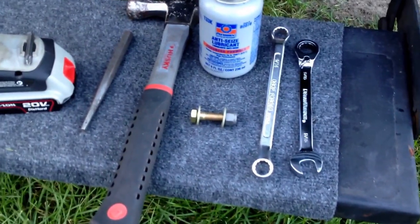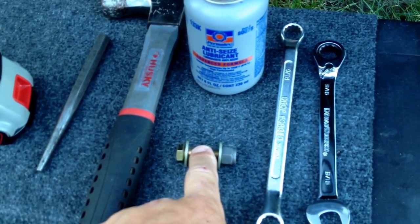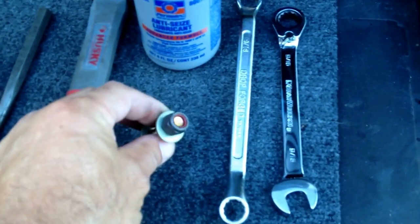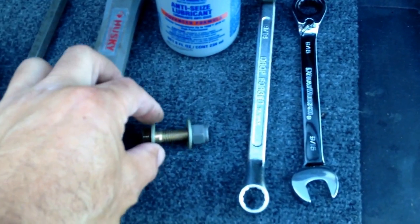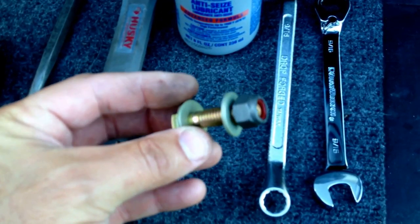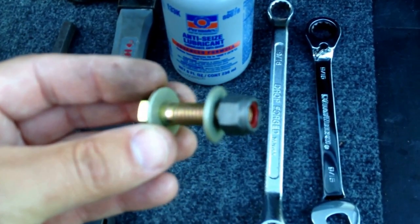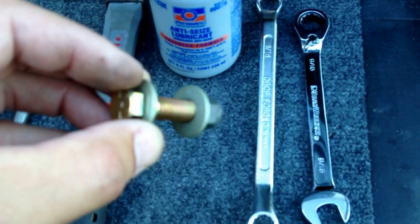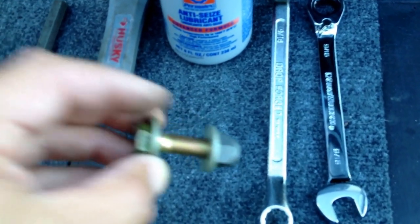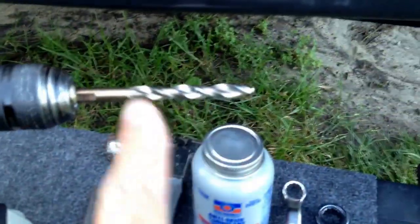Alright, for fixing the electric step on the Champion, we've got two 9/16ths wrenches, a 3/8ths bolt with washers and a nylon lock nut — it's got to be a locking nut for this. I chose the 5/16ths washers because they fit nicely on a 3/8ths bolt. The 3/8ths washers have a lot of slop around them, the holes just seem too big, so I chose these sized-down washers that fit perfectly since they're going to act like sort of a bushing. Then our anti-seize, a hammer, a punch, and our 3/8ths inch drill bit.